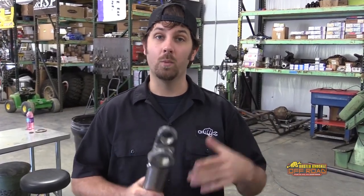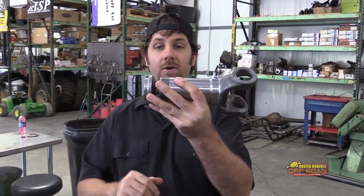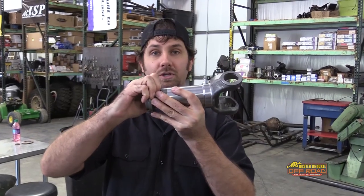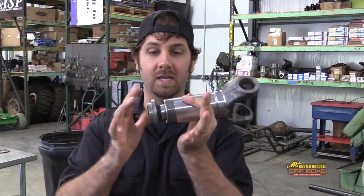One thing you have to be absolutely sure about is that the drive shaft does not bottom out when your suspension bottoms out, because it will break all sorts of stuff. What we do is go to full stop on your yokes and then pull it out 3/8 of an inch. Cut the tubing to that length so at full bump you still have 3/8 of an inch before it bottoms out. And if it does bottom out, we have that little safety cap we talked about earlier.